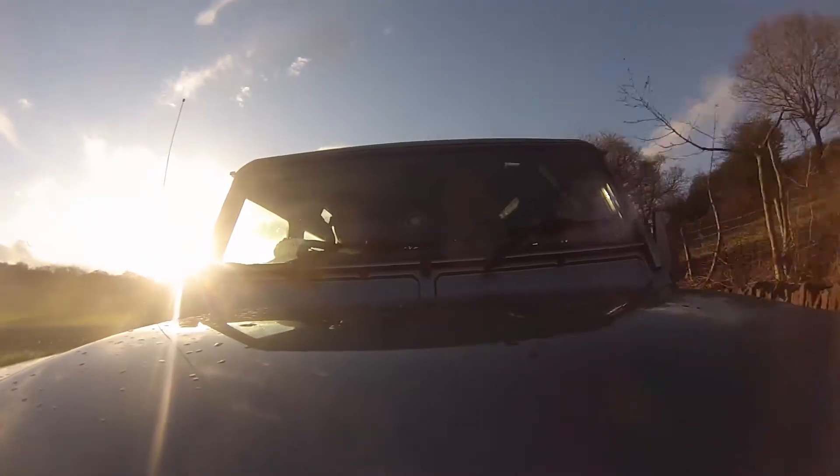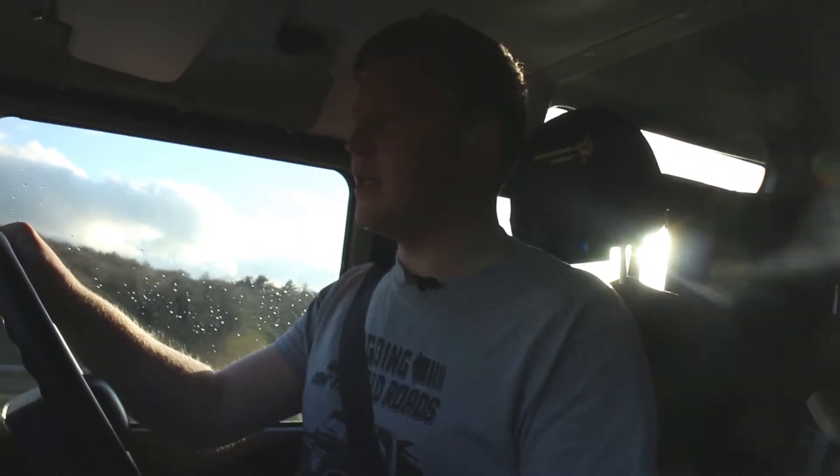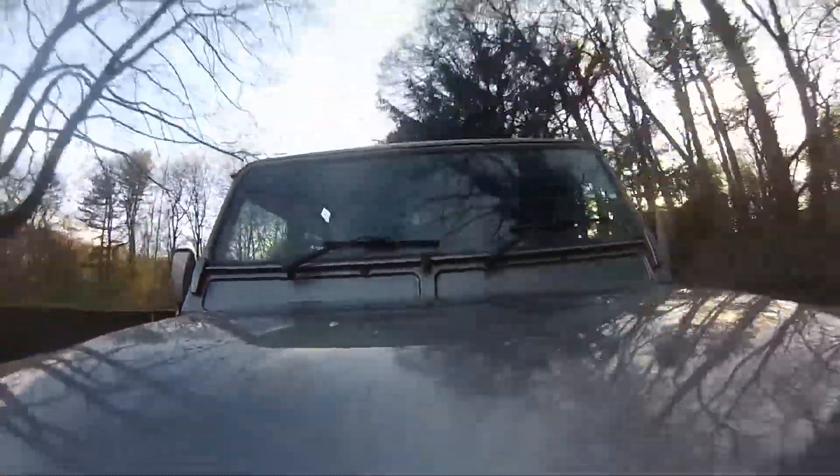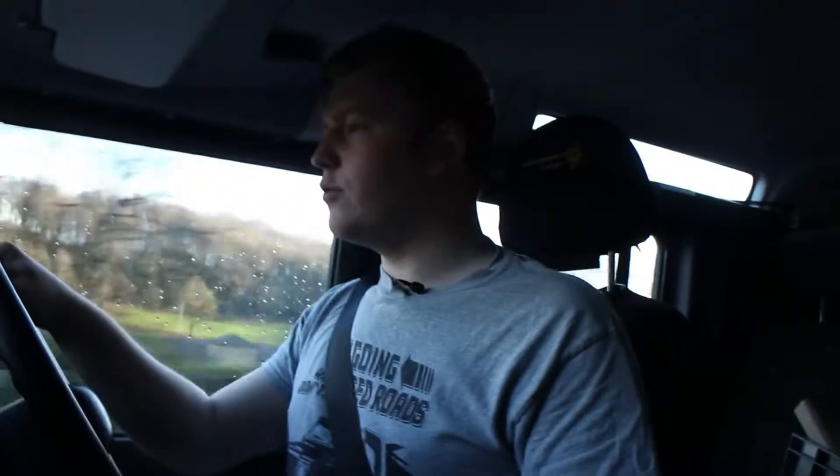You need perhaps a weekend, plus time for drying and the steam cleaning drying time. It's the perfect time of year to be doing this job — in winter the air is cold, your chassis is cold, and you get a lot of salts. Now it's a bit drier, we don't have as many de-icing agents on the road, and the ambient air temperature is warmer, so it's more pleasant for you applying it and more within the rust proofing products' specifications. It's also a nice time to get under your vehicle and see what winter has actually done to your Land Rover's chassis.